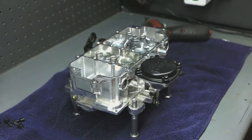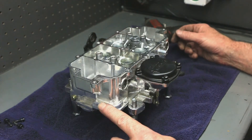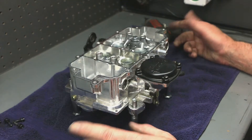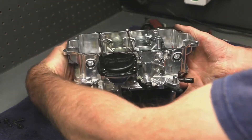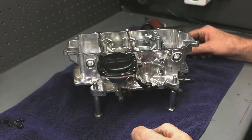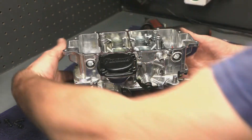The original 4100 fed from the body. The Holley 4010 and this one feed from the top. I have no preference — it was kind of neat. The original 2100 and 4100, you could run them with the top off and they would run that way, because everything was in the body.